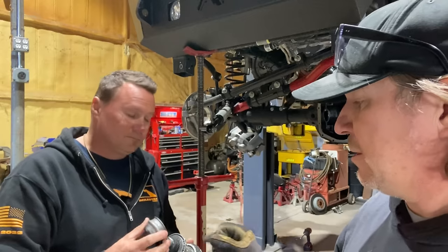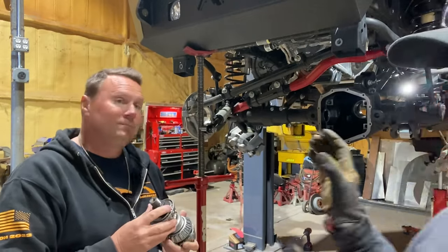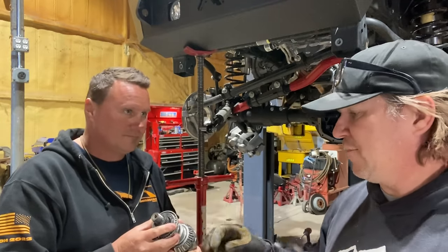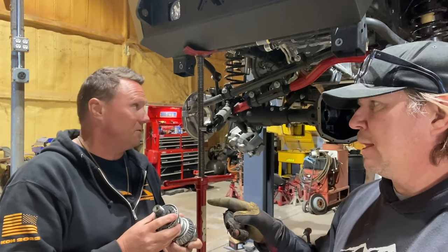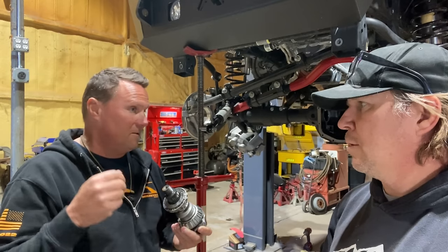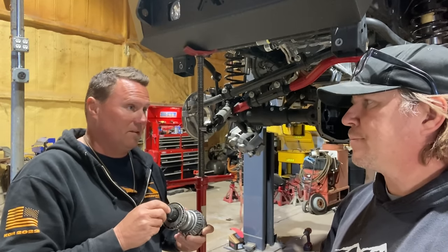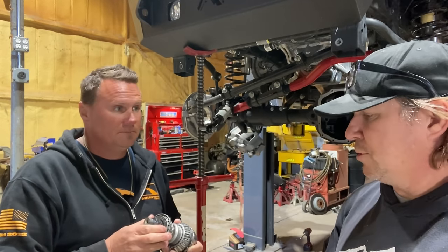So, that being said, if you put different drive shafts in, which we'll probably do later, and you're changing your pinion flange or yoke, whatever you're attaching the drive shaft to, you don't want to crush it any more than it's already been crushed. So I always say you're going to run it in there with your impact, and you don't want to give it all the gun, just a couple of ooga-doogas. Make sure you've got your red Loctite on it. You might even want to peen the nut when you're all done, but don't crush it anymore, because that'll overload the bearings, which is good to know.